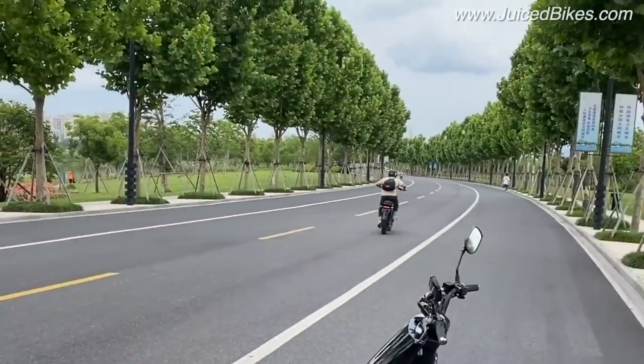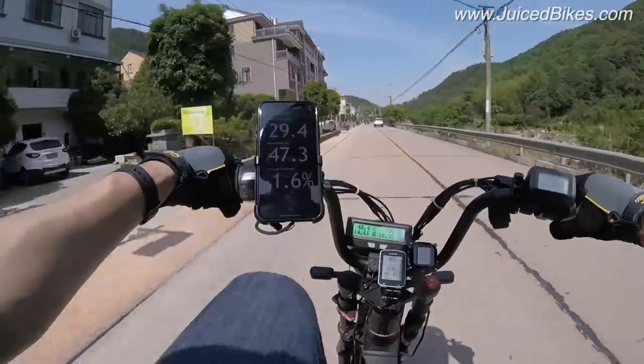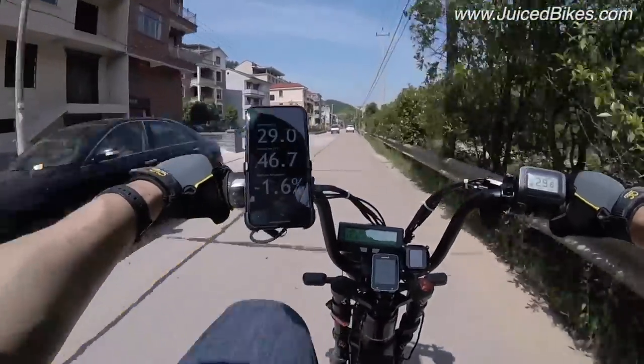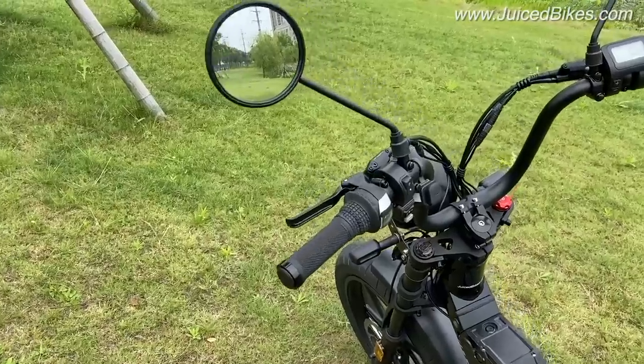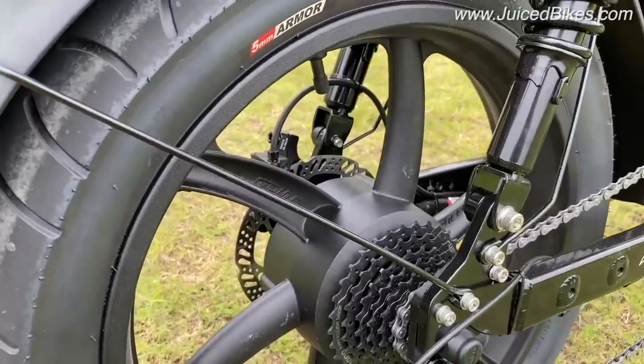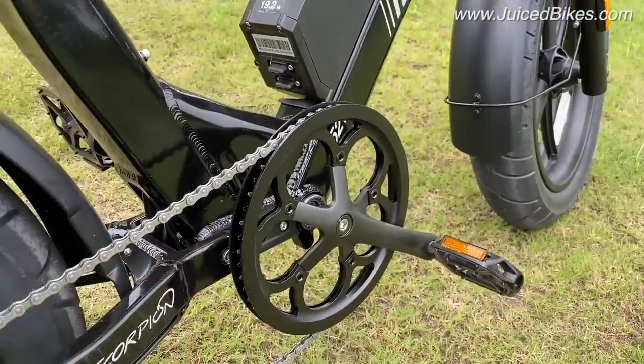It's not necessarily something you would think about when looking for an electric bike, but after using one for a while you know you need a very big gear ratio so you can pedal comfortably as the bike picks up speed. This bike has an 8-speed transmission — that's a cassette. Your smallest cog is 11T and your front chainring is 56T.